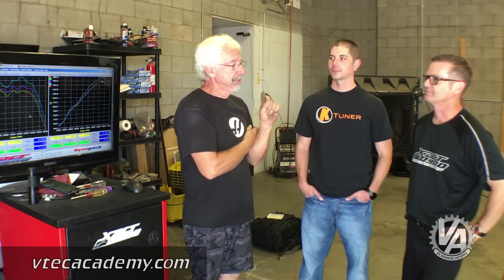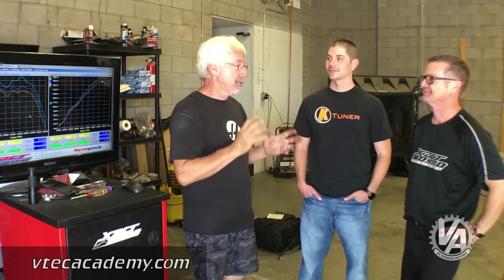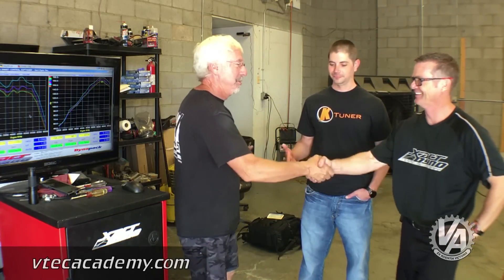Let's try a different header and do some stuff with the intake — I'll switch to the TSX intake and runners, and do a cold air intake since my hot air setup up in the heat is going to be a big problem on the road. On the dyno in the shop at 90 degrees we were seeing 110 to 115-degree intake air temps because radiator air was blowing back onto the intake — it'll be way worse on the road. So we've got a few things to try, and then I want to do cams after that. Hopefully we can reach our goal of 200 horsepower and get Type S-level power out of this budget build. Thanks guys!